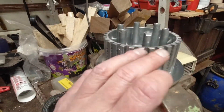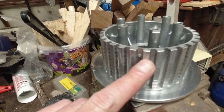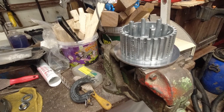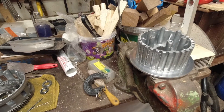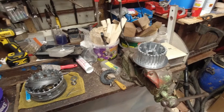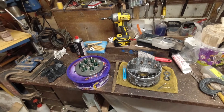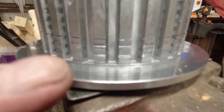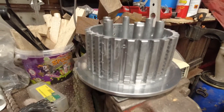Looking at the hub, it was hot and wet at the ends but bone dry in the middle — and that's where all the damage is in the clutch. Also the diaphragm is very very blue, so it's got quite hot. The other thing I noticed was they'd put the thinner friction plates back in with the anti-judders but hadn't put the wire on them. Well, if you're not bothering to put the wire back on, don't bother with the anti-judders. Which means it's damaged the hub a little bit where they've been rattling around.